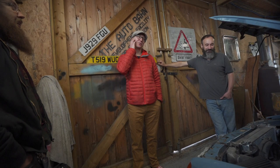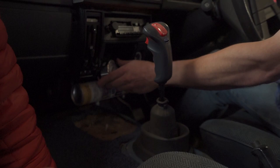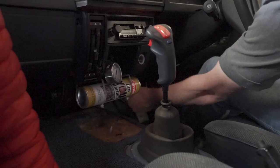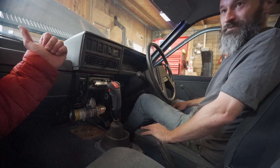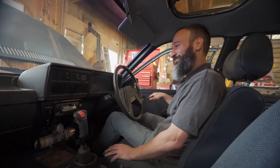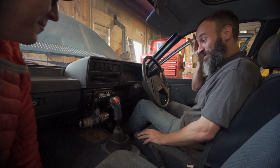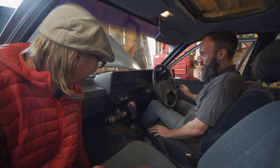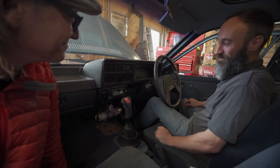You need to see the starting arrangement — it's quite interesting. You switch your vent on and then spray starter fluid whilst you're cranking. That's piped directly into the inlet manifold. I've got no glow plugs because I removed them to decrease the compression ratio, so that peak cylinder pressures don't cause instant head gasket failure — or worse — when I'm running a reasonable amount of boost. I've probably got way more air than fuel I can supply at the moment, so I'm going to be pump-limited on this setup, unless the tiny original turbo just strangles it.